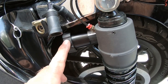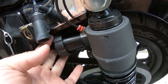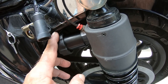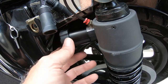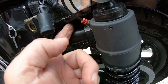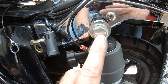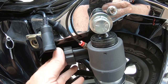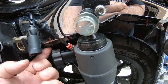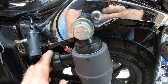I've run into another problem — this adjuster is right up against what looks like the bottom of the frame or the fender. I cannot turn this dial and if it's resting on that it's going to screw up this shock. I loosened it all the way up to try to get it in, so now I'm going to do the opposite and see if I can get it up further. What I did was take it back out, wound the adjuster all the way up to its highest position — maximum weight setting — and it's now clearing the bottom of the fender. I was able to get the bolt on.